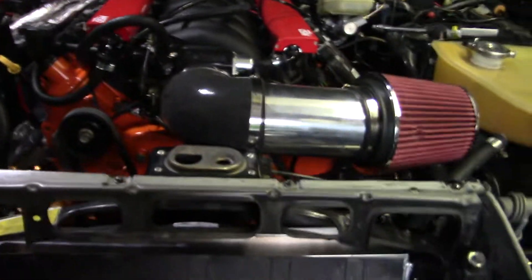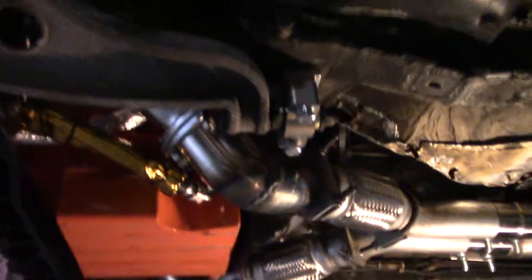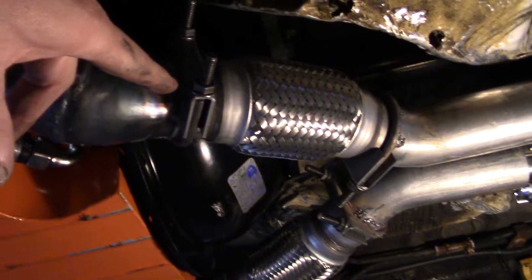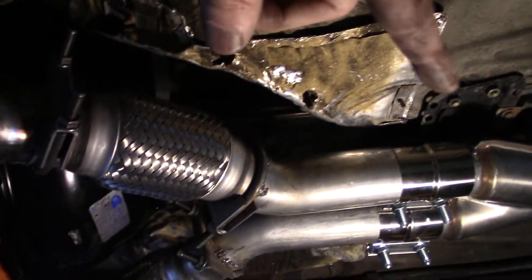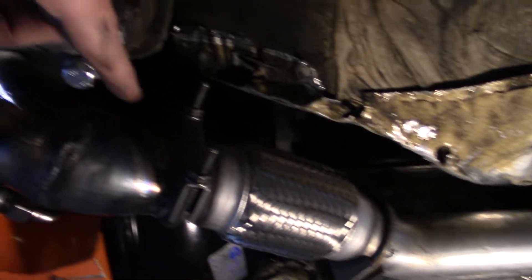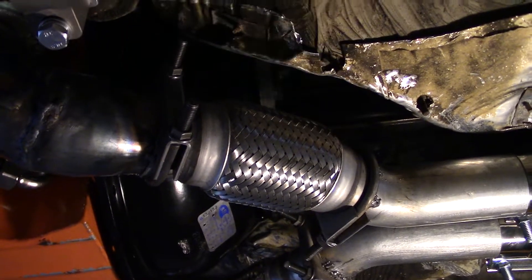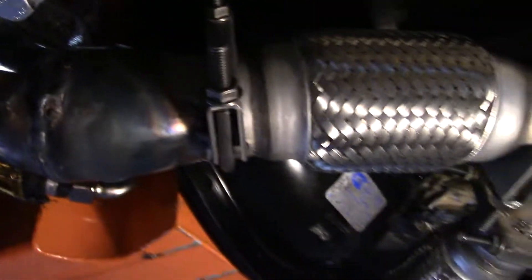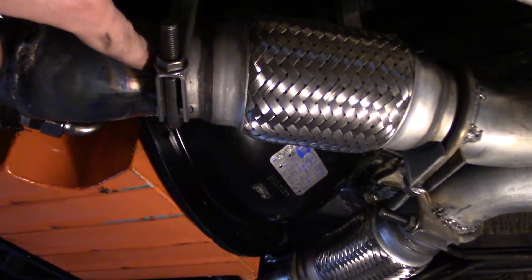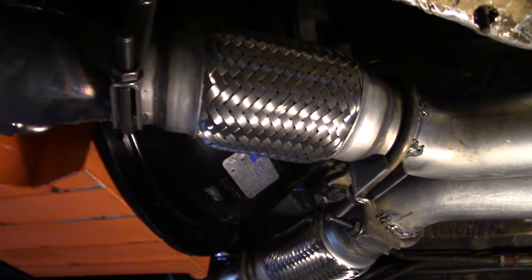The exhaust system is all on there with its gaskets. There was a welding trip yesterday — many thanks to those guys for pitching in to help the project along. There's the weld. The band clamp-type stainless steel exhaust clamps wouldn't fit here because this is pretty much shortened, so I used old-school type clamps and booger tack-welded the pipes together in two spots, so hopefully that holds together.